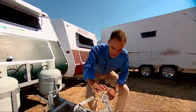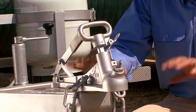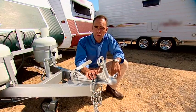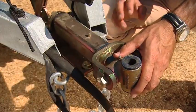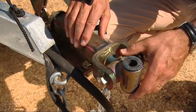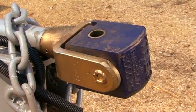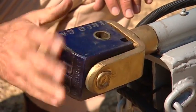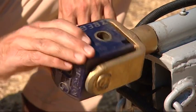One of the most common couplings you'll see these days — typically if you buy a van or caravan — is the fixed coupling: a 50mm ball coupling that fits onto your standard tow ball. But there are a variety. For those buying an off-road rig, this is one example of a swivel coupling that gives you a little more flexibility off-road. Another example is a slightly different configuration of the swivel coupling, typically used to get in and out of steep locations on really rough road where you need flexibility between the vehicle and what you're towing.